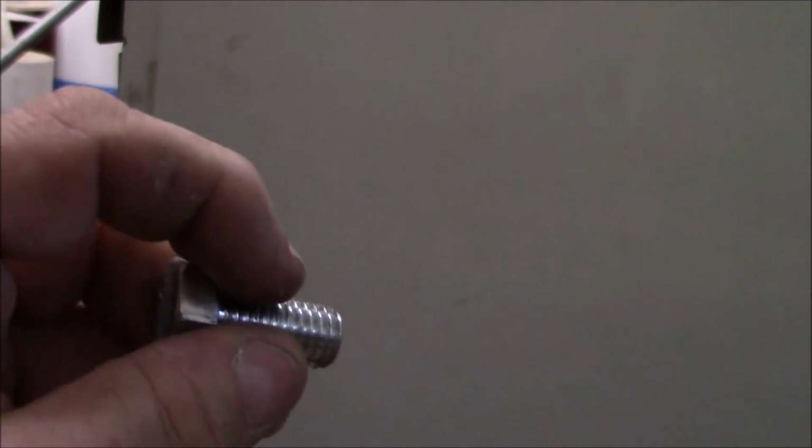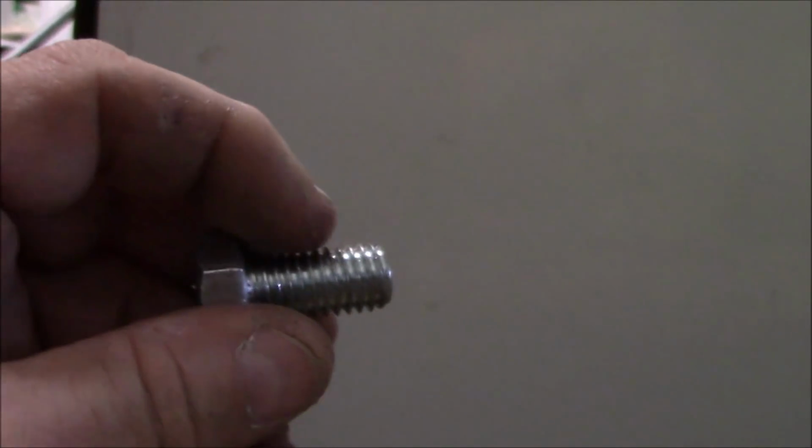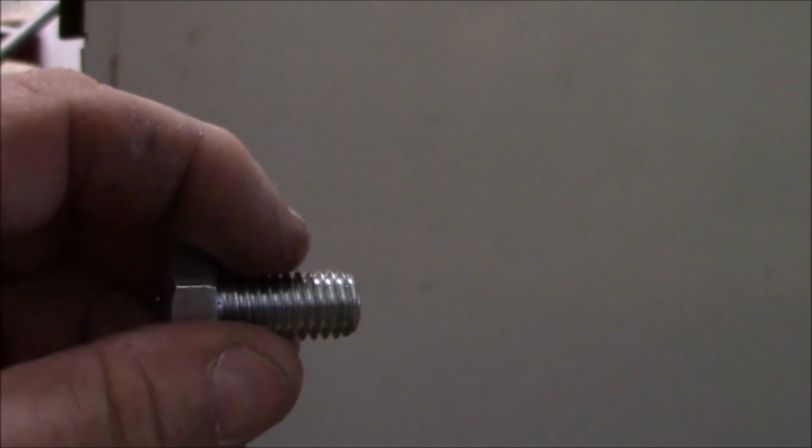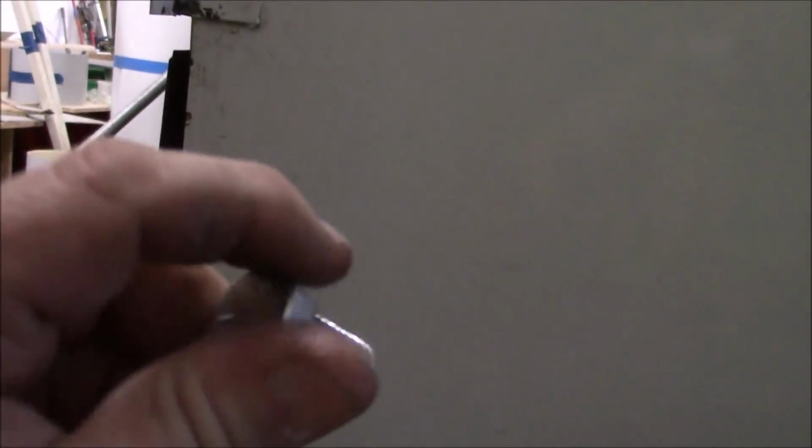That stuff is an adhesive. So what it's gonna do is lock the threads in, but the other advantage is that it will absorb shock. If you put something like an epoxy that's gonna crystallize or harden up too much, then it won't be able to absorb the shock at all from these things. So that's why we're gonna use the M1. We're gonna put it right in there, and this thing is gonna be stout.